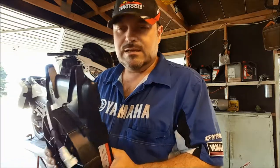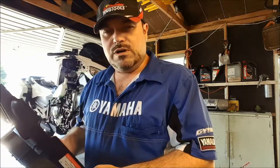Back again. Right. We've been doing lots and lots of work on a 2013 Yamaha Viking. And the last video that was posted was about two weeks ago. And that covered a road test on the vehicle after we'd rebuilt the engine, put it back in the machine, just to sign it off. And we found that the coolant fan on the radiator was inoperative. A few quick checks using a test light, we found that the circuitry on the vehicle itself, the relay, the fuse, everything to do with providing the fan power was working just fine.